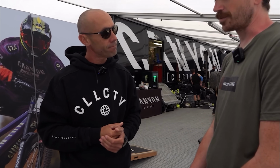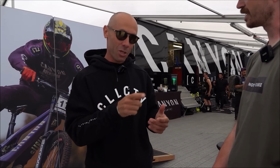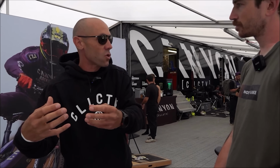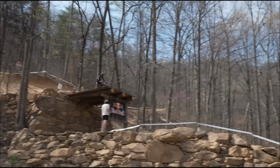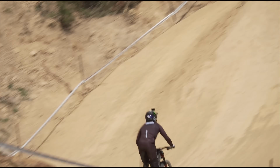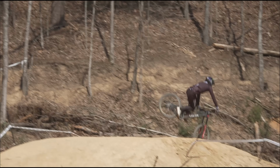Yeah, because I want to say it has a relatively high bottom bracket. I want to say it's like 350 or something. But there is a reason for it. Yeah, exactly. With the rearward axle path plus the anti-rise, it's something that you have to anticipate when the bike is functioning compared to when the bike is static. And this is all combos and things we tested, and this BB height could be adjusted when we did the test, and that's a part of the global package.